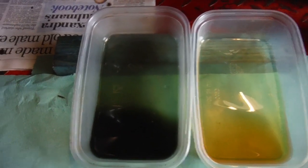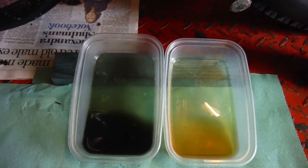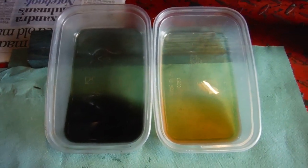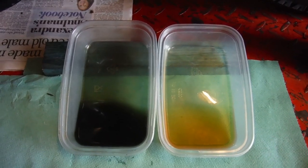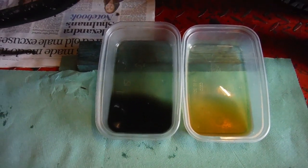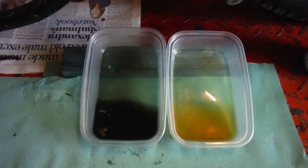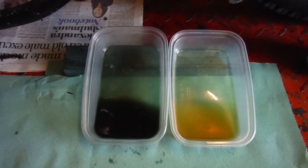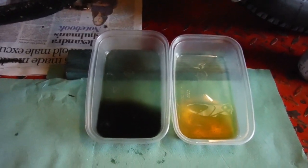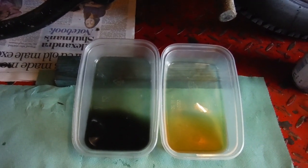My next part of the plan is to start the engine cold with this oil in it and get readings off the pressure gauge I've got fitted to it — see what pressures we've got at various RPMs. Then I'll drop the oil, put some of this new stuff in, let the engine cool back down, and give it a try to see if the pressure readings increase. I suspect and hope they might. If I can find 5 psi, we would be comfortably within factory tolerances according to the service bulletin sheets I've got to refer to.